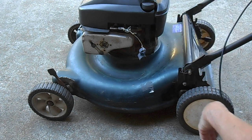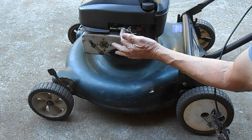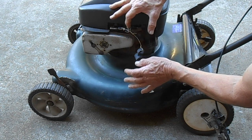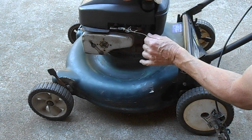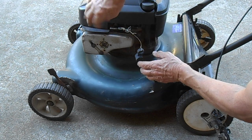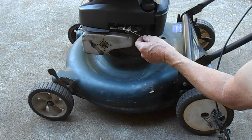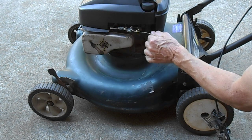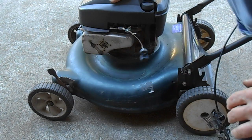You remove the spring, remove the cable, reinstall this, and you're left with this kind of setup - just a household spring. You can order them off; I got a bag of about twenty or thirty of them for like two bucks. This mower is now ready to run and it's going to run until I shut it off by doing that, which kills the engine because that little point up in here is now going to touch the wire that connects to the ignition coil. When the mower shuts off, I just let go and the spring brings it back.